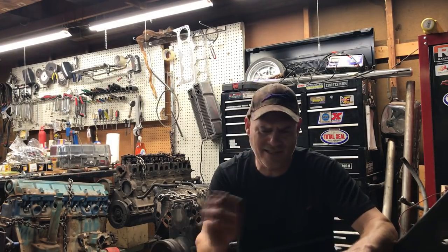It's a wrecking yard motor that's been on that dyno for about two and a half years. We just make pull after pull after pull on that thing and it just keeps running. It's consistent. We change intakes, we change headers, we test all kinds of intake and exhaust systems on it. And that thing is consistently 475 to 480 horsepower. That was a motor that came out of a wrecked truck a couple years ago — all dirty and greasy. We did a cam change, rings and bearings, and a couple of other little things, but other than that, that motor just runs.